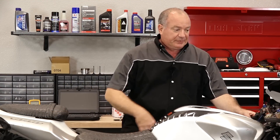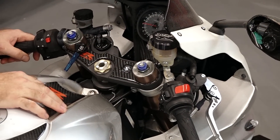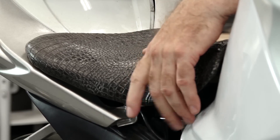Alright, let's start — or let's see why it won't start. Flip it on and there's absolutely nothing there. Well, first place we need to head is under the seat, so remove those two bolts on the side and just lift it out of the way.